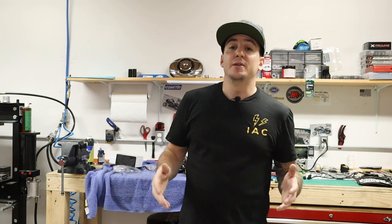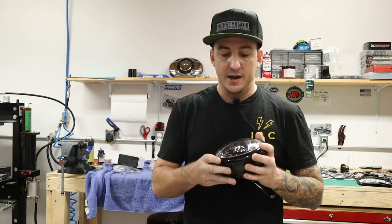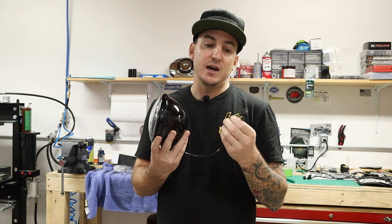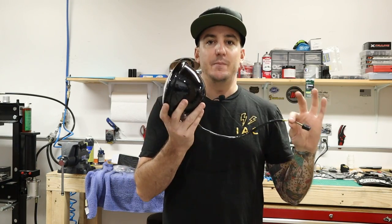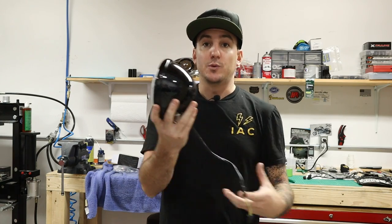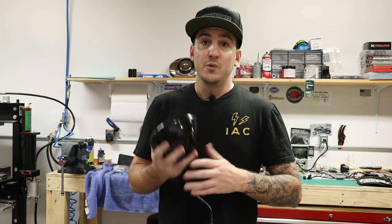Doing the install — there's a million videos out there on how to install these kinds of lights, so I'm not going to get super into it. But what I will show you is the way we're going to do it. Over here we've got the headlight that we took off of our Dyna, and this has already got an upgraded LED headlight in here. We've taken it off and disconnected the quick connect from inside the neck of the bike. Real simple — what we're going to do is tap into these two wires, which are our high beam circuit and our ground wire, and that will power that light. We'll make those connections all the way back here by the plug so that it lives inside the neck of the bike — it's protected and it'll look clean. Out from that right side hole on the frame, we're going to have two wires that come out: one will go to the headlight, and one will go to the new light mounted directly below it. This will all still be modular so it can come off — if you ever need to take your headlight off, you'll be able to take that light off as well.